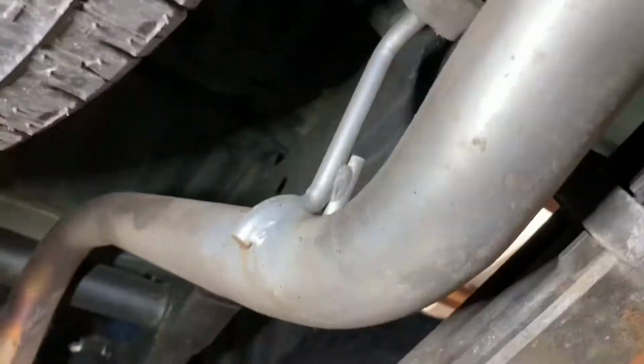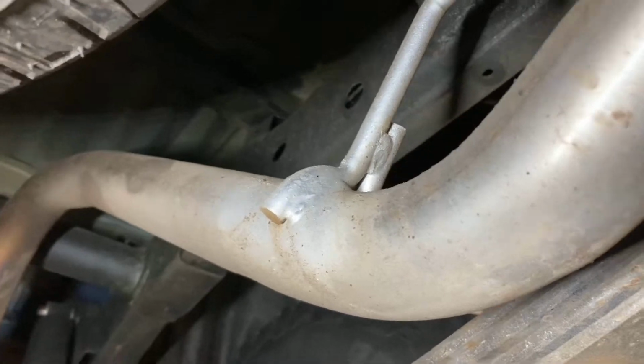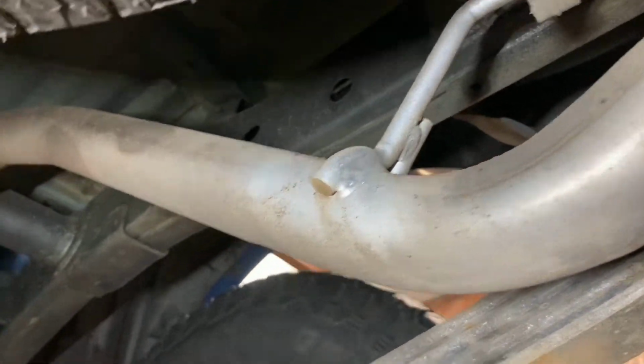As you can see, I've coated the welded joints on the exhaust where the rust was with some high temperature paint, just precautionary work. Come forward here, you can see all the chassis being coated with the clear wax oil all the way along. You can see it better there. All being done, the full lot. I spent ages doing it all. Don't worry, those lines you can see aren't a line that I've done and then I've missed the rest. That's just where it's gone on a bit thick. The whole system is done.